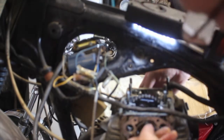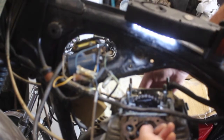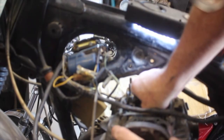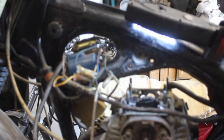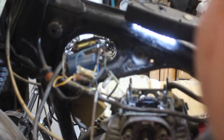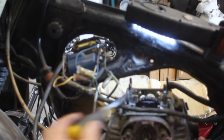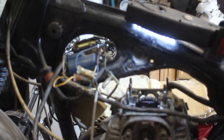And I think that's probably about there. Because you can see, actually it's probably closer to that. That would be where I want it to be. So I'm going to hold that, and then I'm going to locate it with this so that it can't drop off. And you'll find when I press the cam chain tensioner there, look, that comes round to exactly where I want it to be, and that line there is now sitting across the plane of the cylinder head faces there, and that tells me that is timed up.